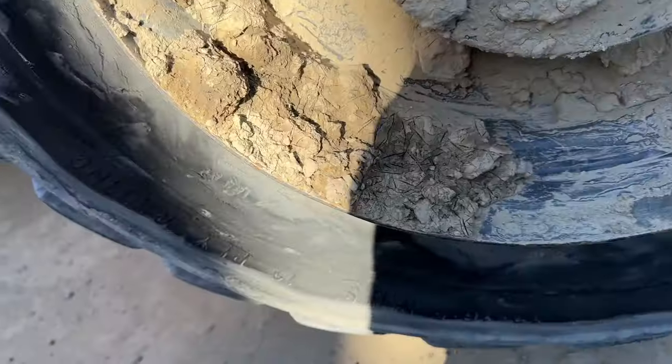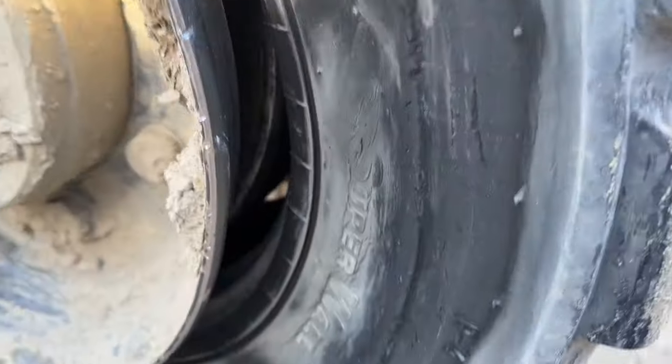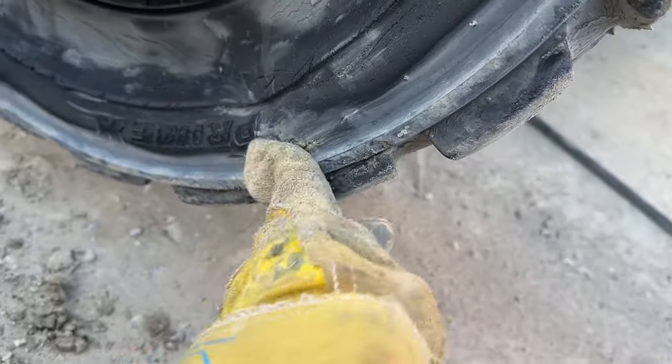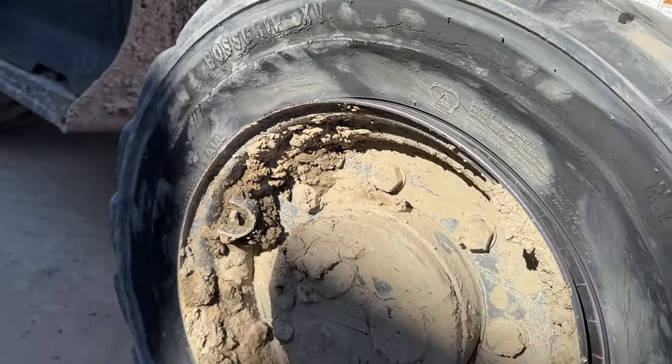When we say a tire has been driven flat, this is usually what we mean. You can kind of see that the bead is messed up in there, but the sidewall, I guess they must have gotten a hole there. And now there's a bulge, and you can see how rubbed the sidewall is. Of course, luckily I always carry a tire this size on board. It's got 50% tread left, but maybe if they didn't drive it, it would have been fine.